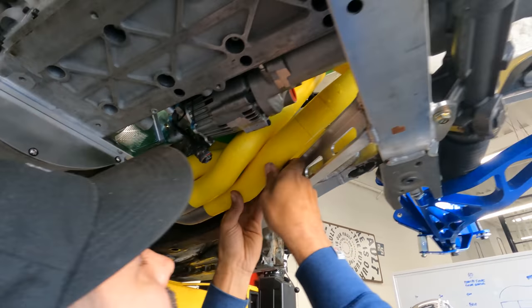Now you really get the picture of how tight it is in here. I mean, look. There is literally no room left to put any more tube in here. And this is the number 9 cylinder that goes up and basically snakes down into this. It looks like an octopus in here, but Dom did a great job making sure every single runner was 26 inches long. So it worked out. And the number 6 all the way in the back comes off and runs straight into the collector. So the collector is in the perfect spot so that the furthest runner away still has the 26 inches. It doesn't have to be any longer than that. And on these really difficult ones, he added just barely enough room to massage that baby in there.